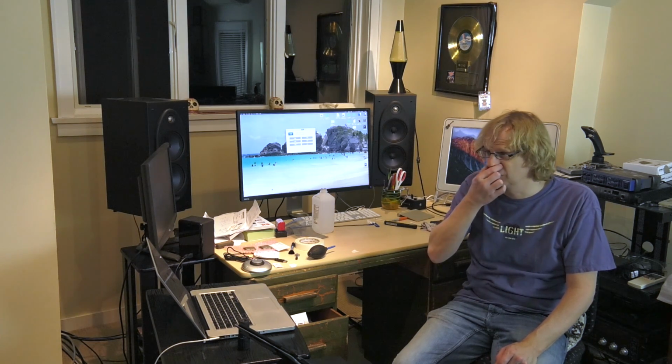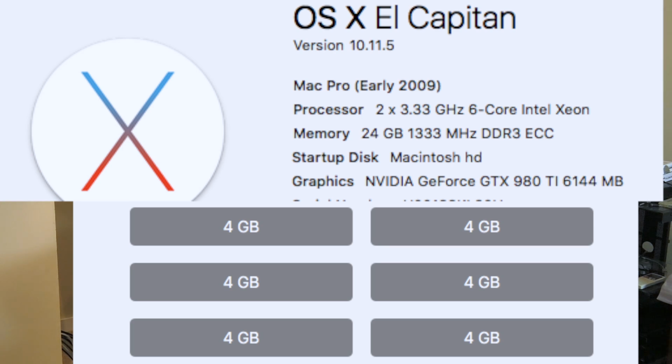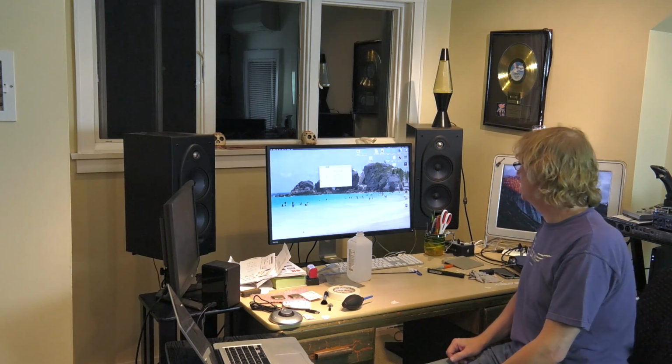I really thought I killed my computer because it just wasn't booting at all, but then I pulled the second CPU out and booted off the first one and it booted. So I was like, oh, thank God, and all the RAM was showing up, so that one was always good. It was the second one that was more futzy, and I'm keeping my fingers crossed that it's all working tomorrow. I started doing this at something like 7 o'clock, not even. How has it taken me this long? Because I refused to give up, and I kept tweaking it. But I think what happened was I was over-tightening it.